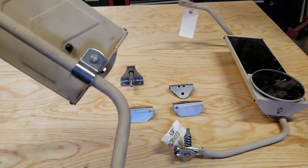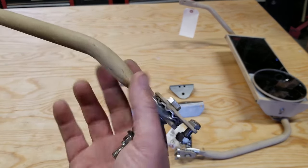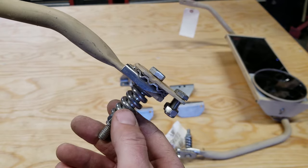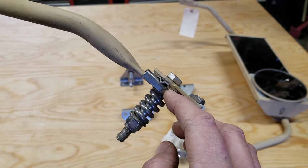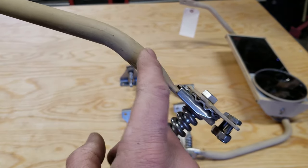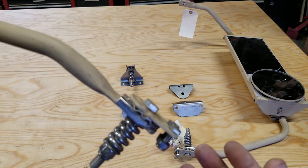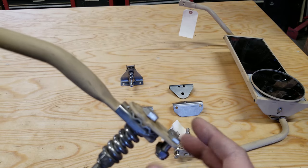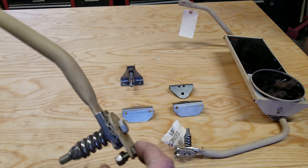Again, that's pretty important. The other thing, and this is the big thing for these mirrors, they use these nice spring-loaded detents with nice stainless steel wear plate assembly that actually is independent of the hoop and the mounting brackets themselves. Now, I did have to make new brackets to accommodate these because the original ones wouldn't actually fit. I'll show you that.